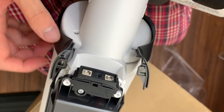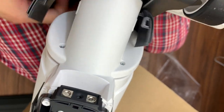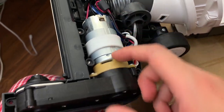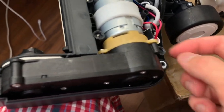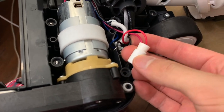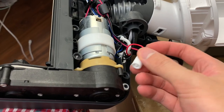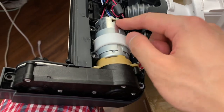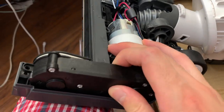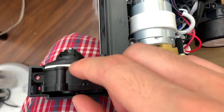Now we head around to the bottom and unclip this little piece of trim — just two clips — and there are some screws underneath that need to be removed. Let's pry up these clips and take out all the screws in the bottom to free the brush roller motor. You can see it's actually got these vibration mounts on it, only on the back, and it's permanently installed with these rubberized wire nuts. Inside you can have a closer look at those rubberized wire nuts — there's quite a lot of vibration mounting going on. There's a little white gasket to keep hair out of the assembly — that's a nice touch.